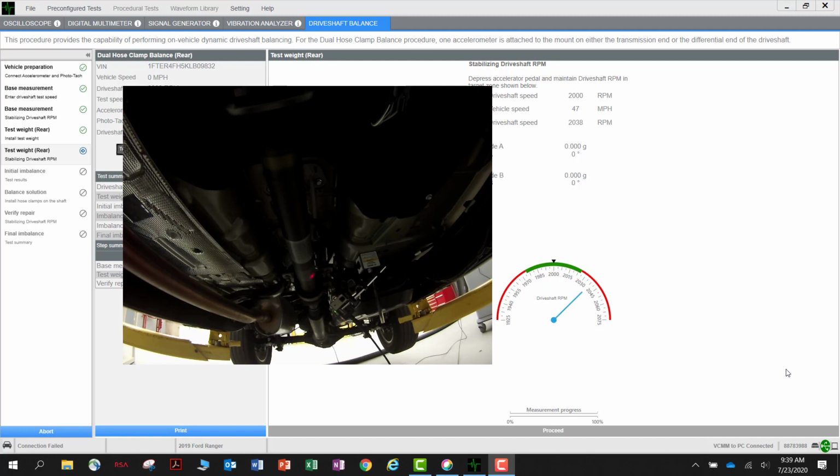Accelerate the vehicle to the speed where the vibration occurs and follow the same procedure as you did the first test run. Keep the blue arrow in the green zone as much as possible while paying attention to the progress bar at the bottom of the screen. Once again, patience is required as the arrow tends to jump around, and it will take practice to hold it steady.